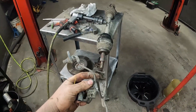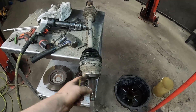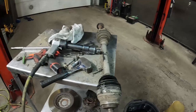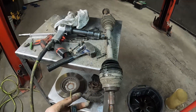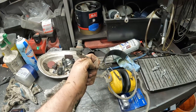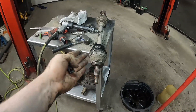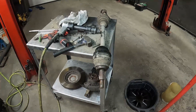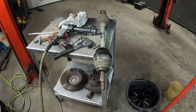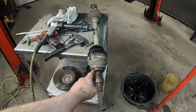The point of this video that I wanted to make is it's not always a matter of just replacing a sensor, or if it's an integrated hub bearing assembly, it's not always just a matter of that. Now more often than not it is, but in the case of the Fords if you have the ring on the axle, check that. And once in a while you'll find a harness issue like this one up here. But more often than not, if you have a single wheel vehicle speed sensor issue, it is almost always the sensor itself. Anyway, I just wanted to pass that on. Have you seen any of these split on any other vehicles other than Fords? I'd be really interested to find out. Thanks for watching — we'll catch you in the next one!